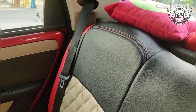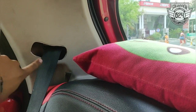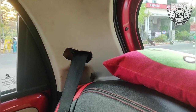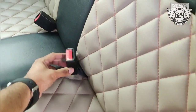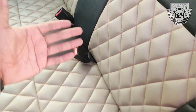This Gen X Nano has the provision for three-point seat belts. If you look at the C-pillar, there is a cutout — that cutout can be opened up, and that is where the three-point seat belts have to be mounted. I have used the exact same factory-fit buckles.